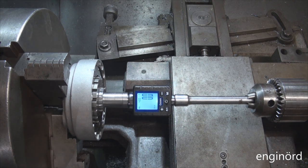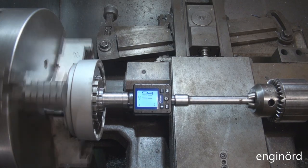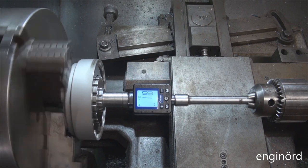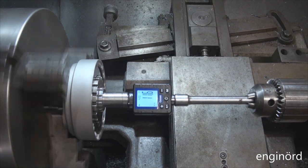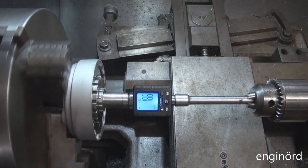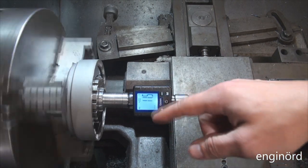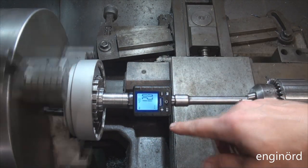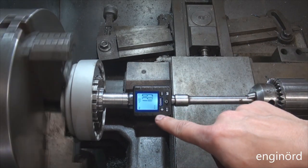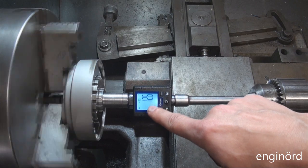Oiled clutch, clockwise rotation — about 11 newton meters, I'd say 11.5 newton meters. As the oil seeps out with no replenishment, the torque climbs — initially around 7 newton meters, now up to about 12 newton meters.